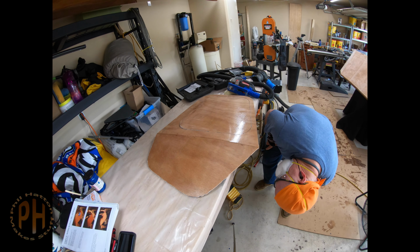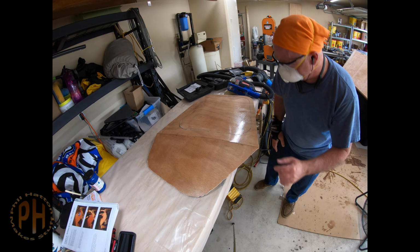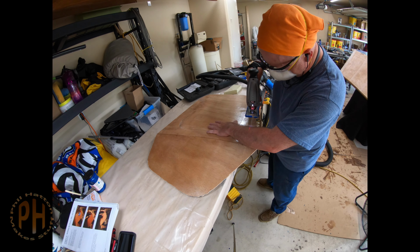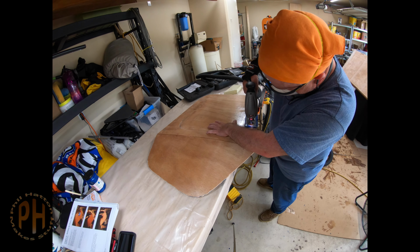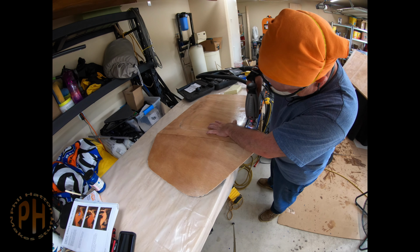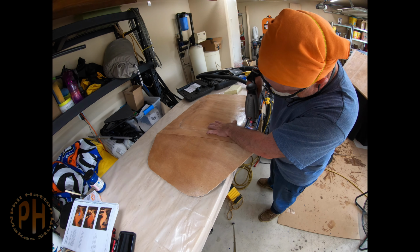Since the corners on the windows have a fairly small radius for a flat saw blade, it pays to cut out the straight bits with a proper saw. But at the corners, you need something that will make a curved cut. This is the only time I let a jigsaw touch my camper, cutting out the windows.